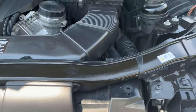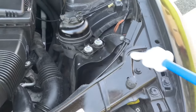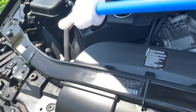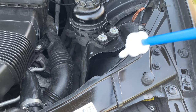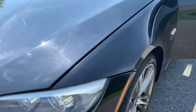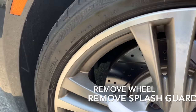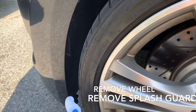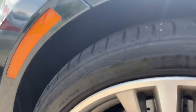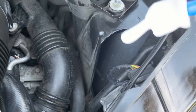Now you know how it works. Since you know your line is right here, you need to get to this line — and most likely it's going to be for the passenger side, so you'll need to access the longest one. The first thing you need to do is jack up the vehicle. Once you have the wheel removed, you're going to need a ratchet with an 8 millimeter socket to remove this splash guard. Then you'll be able to get to this line and pull on it to open the hood.